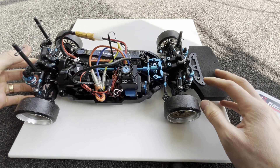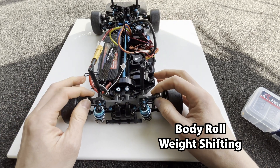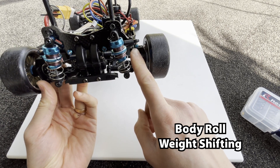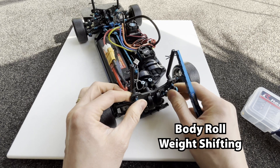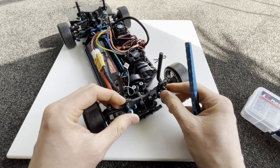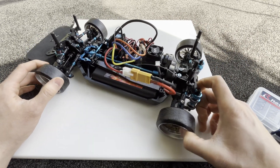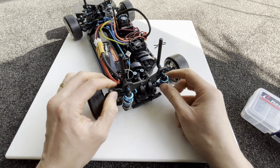What we really want when drifting with the 50/50 is for the car to tilt forward so there's no weight in the back — that makes the back slide a lot easier and swing the car around faster. The whole point of this exercise is to increase the roll center. The inner ball joint is lower at the front, and I'll increase it much higher at the rear. You want a high roll center at the back always — it'll make the car feel lighter and make the drift smoother.